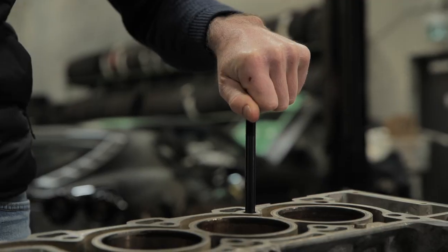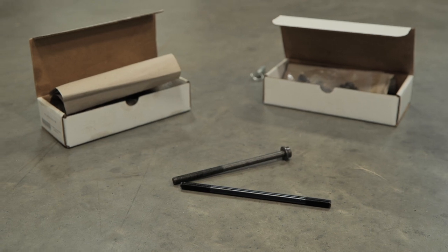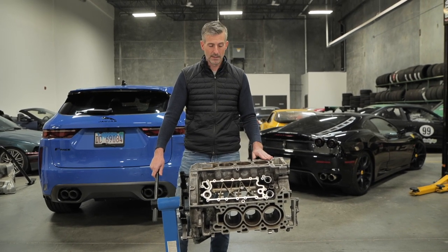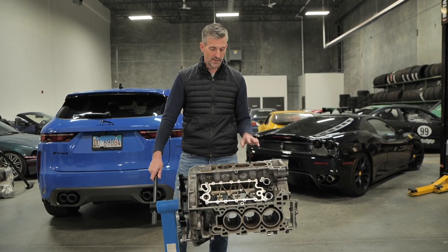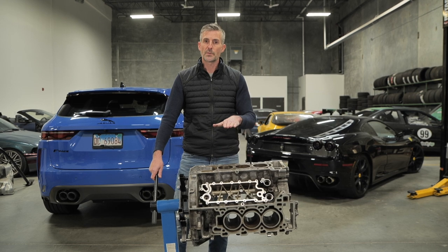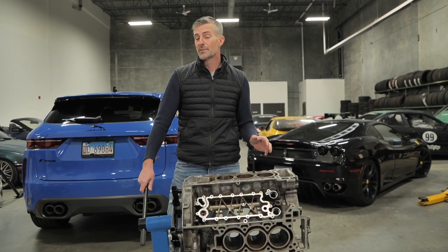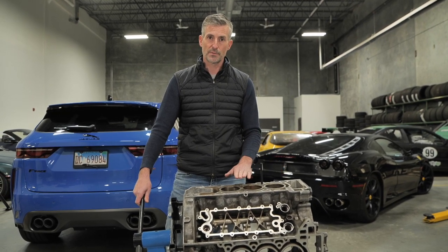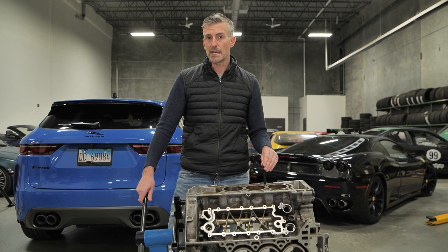What is the advantage to doing these in the case of the JLR three and five liter supercharged engines? They come with a head bolt, which isn't as strong as a head stud. We've also upgraded the material significantly. These are aluminum blocks with aluminum heads, and one of the challenges with aluminum is that the thermal coefficient of expansion is three times higher than it is on steel. So you have the block and the head both trying to expand as they heat up, with the fasteners holding that all together. Over time — especially if the engine gets hot, overheats, or if we tune it, increase boost and increase in-cylinder pressures — there's more heat causing expansion and more pressure trying to push that head up off the block.